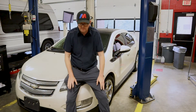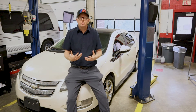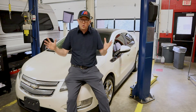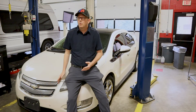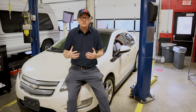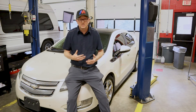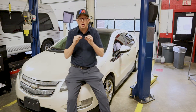Fortunately we were able to get this car fixed for a whopping $168 for a battery, and again this car had sat at different shops for over six months and they could not identify or fix the problem. My only advice for working on these vehicles is to keep it simple. Something very simple such as a 12-volt battery can cause the whole car to go haywire. I know they're complicated vehicles, but if you just take it back to basics and rely on your training, a battery test six months ago could have fixed this car. The fact that two shops missed this repair is really concerning for our industry.